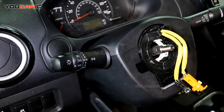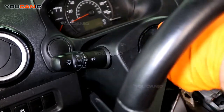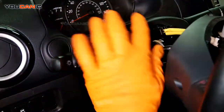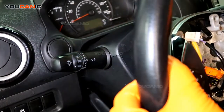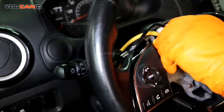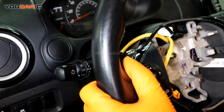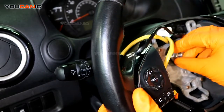Take the steering wheel, line up the wires and fish them through the steering wheel. The position of the clock spring is very important — it should not move much, which is why we had tape on it. Remove that tape now. When reinstalling the steering wheel, use the alignment marks you made during removal so the wheel is not off at an angle.